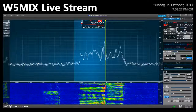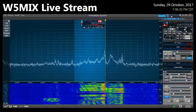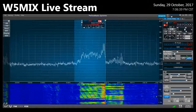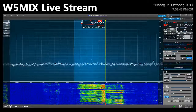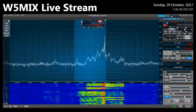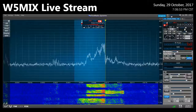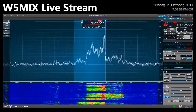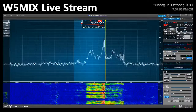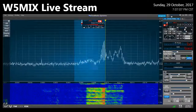Okay, cool. It pressurizes that whole case, and I tell you what, they run a lot cooler when you do this. I've had one of the 76s before I did this too, and it worked out really well. Oh yeah, you probably increase your volume by 2.5 times. Not by that much. It goes to about 40 CFM from 30. It's still got to squeeze through that little bitty squirrel cage fan, which in free air is rated at 40 CFM. So with pressurized air feeding into it, it'll do 40 CFM. Well, anything more is a plus.